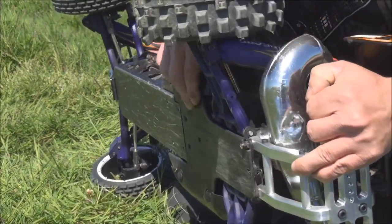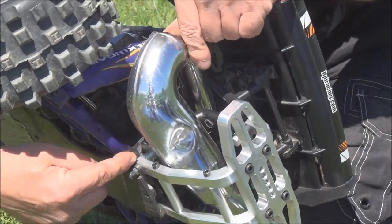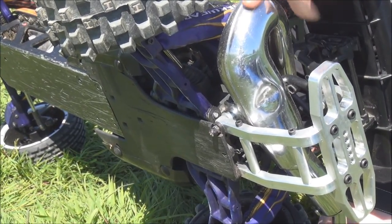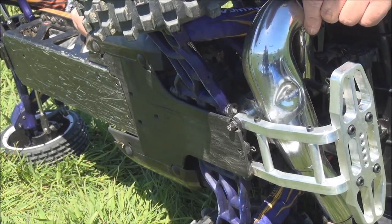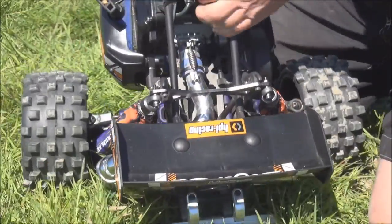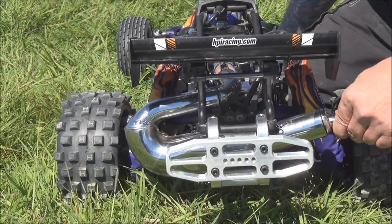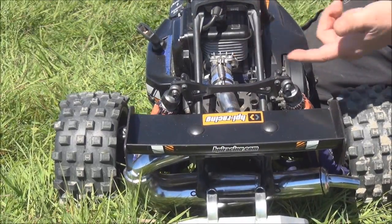And the other thing I did to the pipe is before I had a rubber grommet on it, because the pipe needs to flex, I had a rubber grommet right here. And I found it didn't work too well, because I did a jump and then it hit something, and this bumper was actually rubbing against this tire. So the grommet didn't work worth beans. So what I did is I put a bunch of washers on it and I made it rigid, solid. And the only piece that really needs to flex, I feel, is the silicone hose here. It's got a bit of play in it, as you can see. You don't need much, you just don't want it moving around. And that should prevent it from snapping off from the head, I hope.